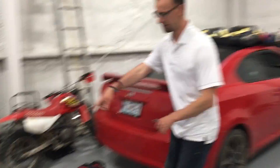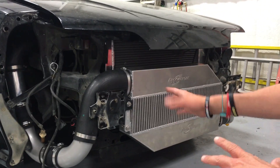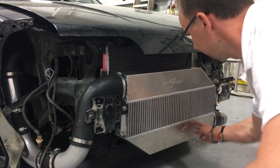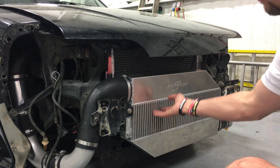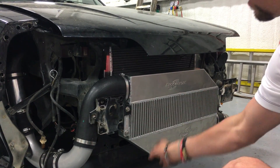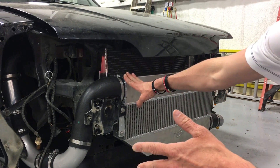Come take a look at this — this is another car with a ProCharger intercooler on it. This is an old-school design; a lot has changed since then, but we still make this. Air feeds in here, goes through a very short air path, into a giant air tank, and out with not much restriction and a lot of cooling area. This is a really good unit.